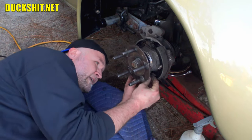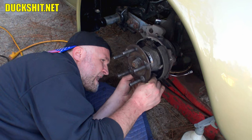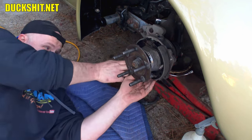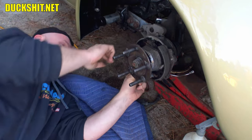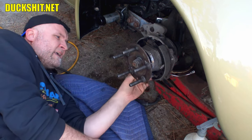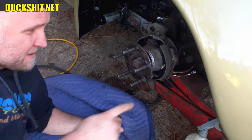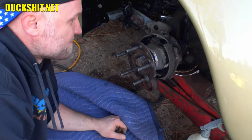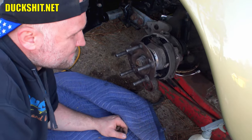And then close this little guy up. Try to get it behind the brake shoe on the right side, and then move the pad out of the way. Wish I could show this to you guys. Oh, it went right in. Alright, I guess I lucked out. Everything looks like it's supposed to be in there. Wait, it is. I had already put this clip back in just before when I was test fitting stuff, so the shoes are back where they belong, so we're good in that department.